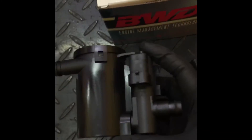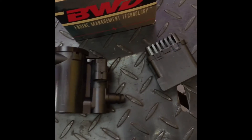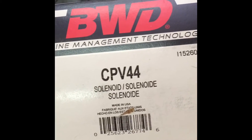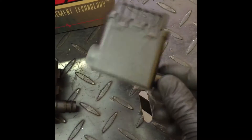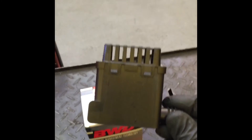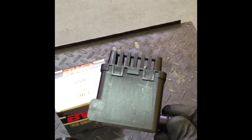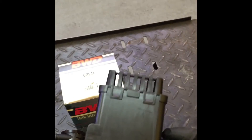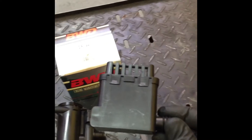Here's what your new part's going to look like — here's the new valve, notice it does not have a hose attached to it. Here's the part number if you're going to get it from O'Reilly's; I think they keep it in stock. And then here's this little filter piece. That hose goes all the way up to the transmission, but this filter is only for if the system has not already been modified to have that feature — and this truck does, and so does yours, so we don't need it.